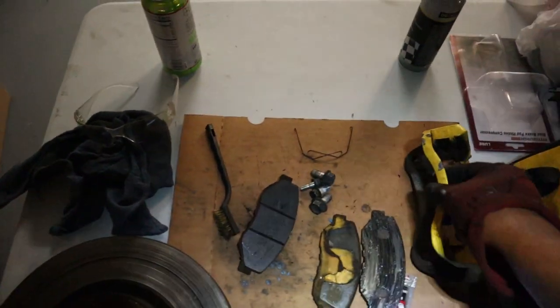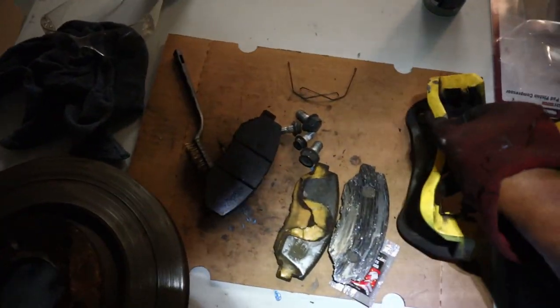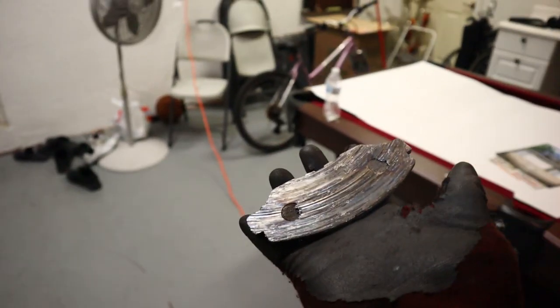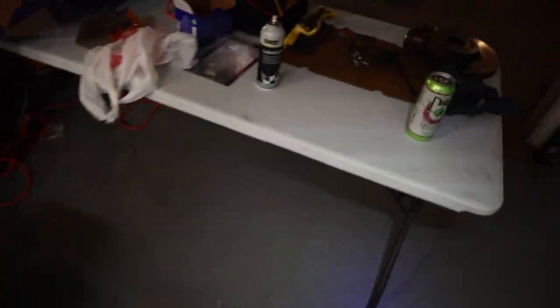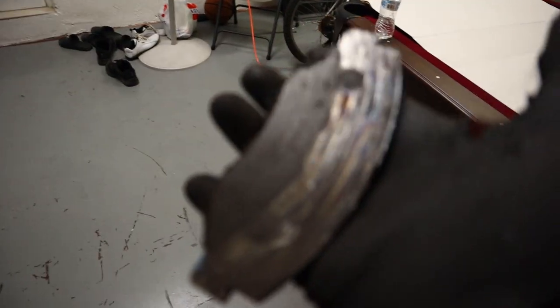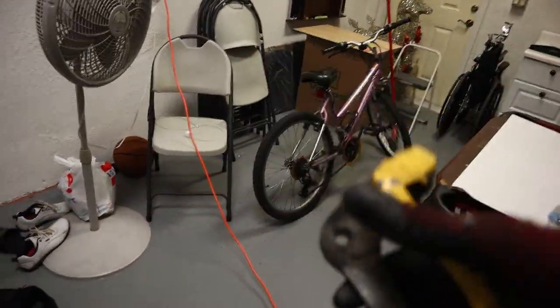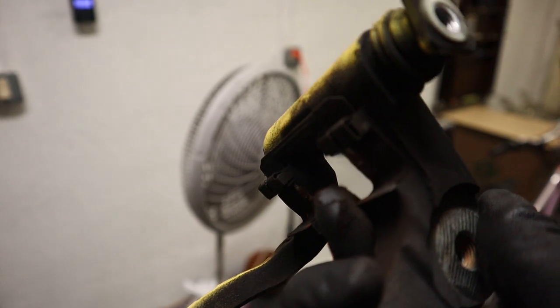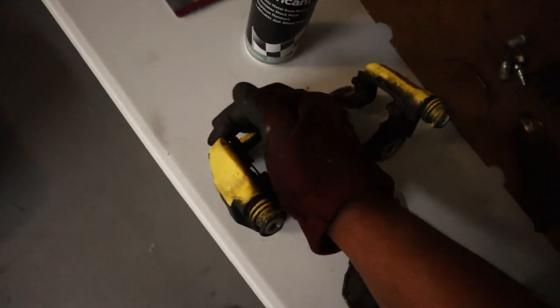Alright, calipers are off. Let me point out the things you need to do. By the way, this is my driver's pad — look how terrible that is. And this was my passenger pad — terrible. You guys, never let your brakes get this bad unless you don't love your life. So now explaining what needs to be replaced — if it's in good condition you don't have to replace it, just clean it. On the driver's side, these clips come off. There's one on top and one on the bottom. If you have a flathead you can pry it up with that, or just take your time and slowly pry it up with your fingers — just make sure you don't bend it.